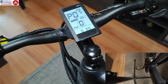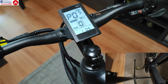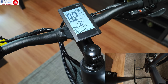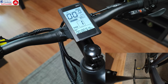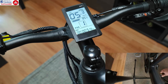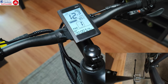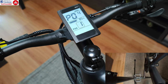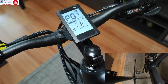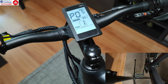If we go back to the settings menu and change the first digit to 1, that means I will disable the freewheel running of the bike — so I will not have the 0 mode anymore. I will only have the 5 assisted gears, selectable from 1 to 5. So it disables the non-assisted mode and the bike will have only assisted working modes. Other things don't change — no speed changes. I also like the 0 mode because this bike has very low rolling resistance and uses little effort, so I find myself pedaling without the aid of the motor a lot of times. And now I can select back the 0 mode.